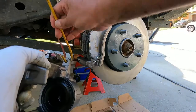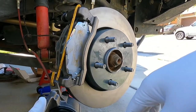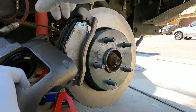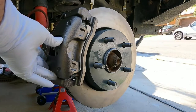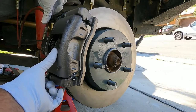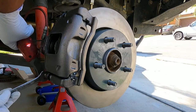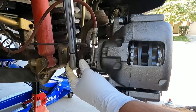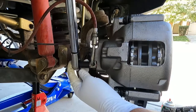So we got it started at least. We made a little mess but not too bad. Let's hang up the new caliper for a second while we clean up. We've got the banjo bolt started - it's a lot easier to torque once the caliper is in place. All I have to do now is position this over the new pads, line it up, and put in these new bolts - they already have some thread locker on them. The brake line banjo bolt is an 11 millimeter torqued to 23 foot-pounds - that's going to crush those copper washers to seal.